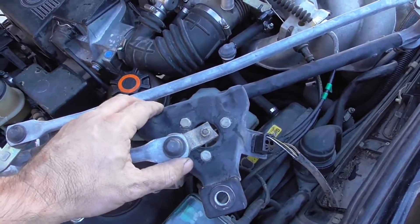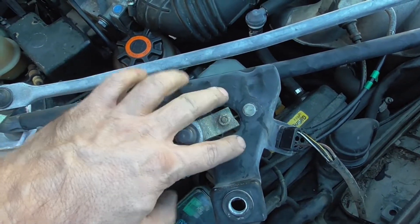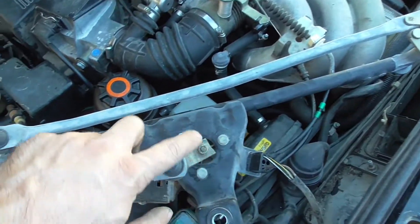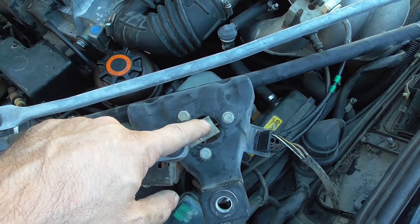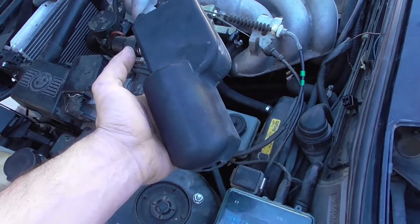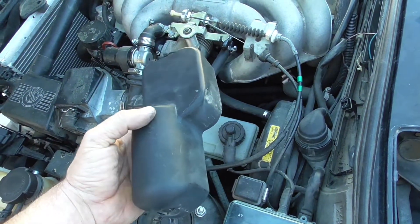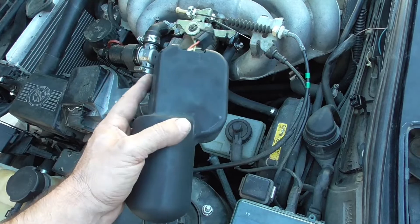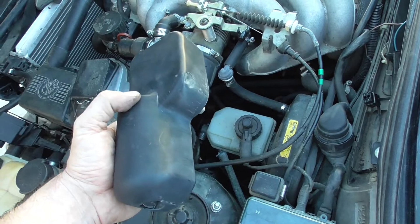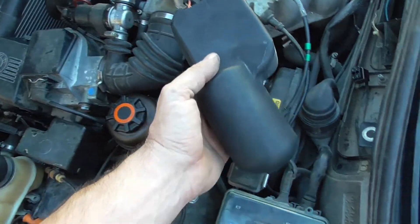When testing the new assembly, you can manually move it with your hand and set it up in position. Unbolt the motor from the assembly, put the assembly back in, put the motor back in, and bolt it the same way. Installation is reverse of removal, but importantly, make sure to put the protective plastic sleeve on the motor before you install it back in.